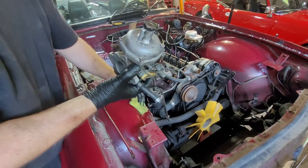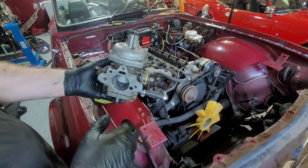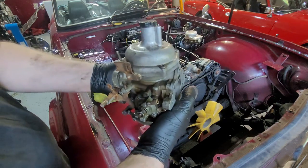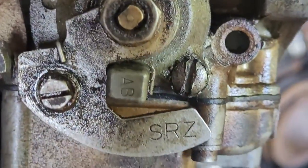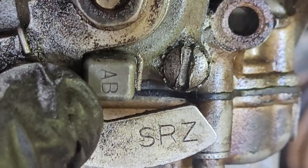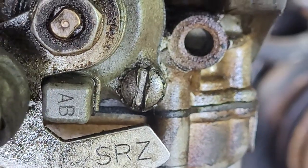When I worked in a car garage they used to actually put fuel in a spray gun and spray the engine around. Anyway, in case you're wondering - someone's going to ask - how do you know which carburetor you have? On the side here, I'm going to try to zoom in so you can see. There's a little stamp. This one says AB - AB for an early model. Usually most ABs are non-adjustable, but there is an adjustable one.